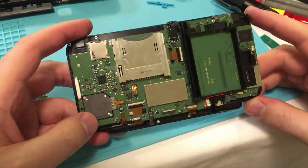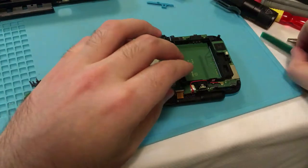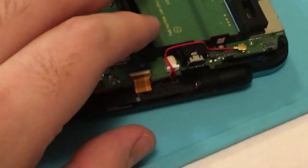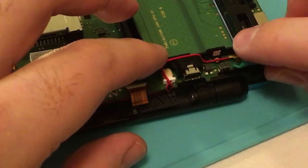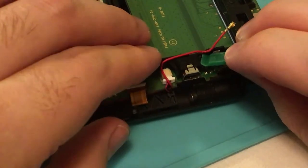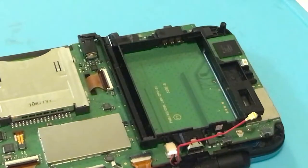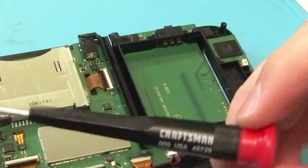There are a couple of different ways to attack this. What I'm going to suggest is first we just pop off this Wi-Fi antenna — that's Wi-Fi and Bluetooth; they actually run on similar frequencies, 2.4 gigahertz, so there's only one antenna for them in this. I'm just using the spudger to get it out. There are little notches where this thing sits — the one where you push down comes out pretty easy, this one you've got to pull up. It feels a little uncomfortable; it's always scary working with these small things, but just get right as close to it as you can and knock it out.